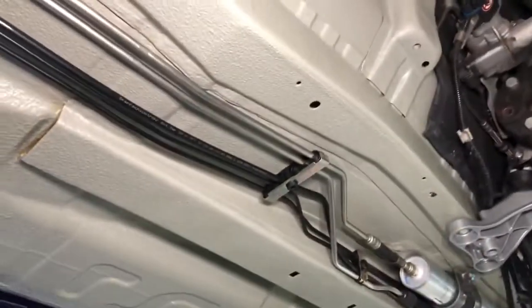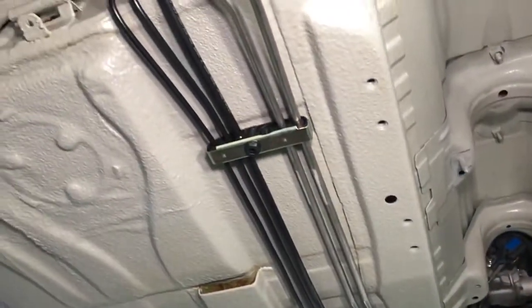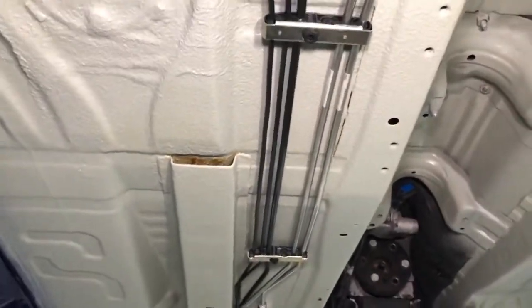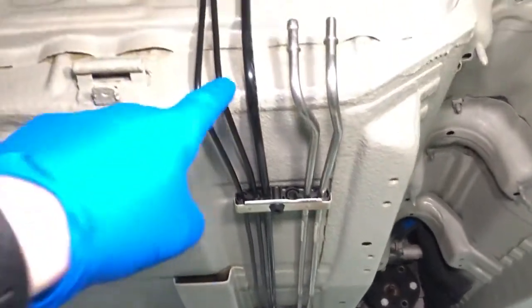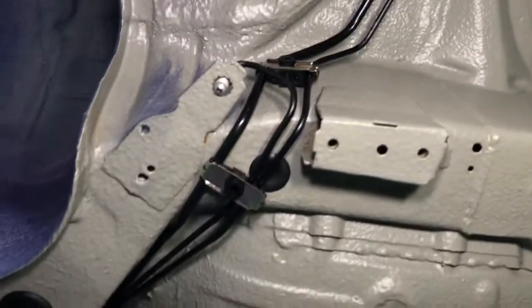Going back to the pipe section, the fuel pipes are stainless steel and have come up perfectly, so we're able to reuse those but clean them. And the brake pipes have been renewed for genuine BMW ones, going through following the parallel lines. That's the fuel vent line there, and then going up around the tank section onto the left hand side to supply the left rear circuit.